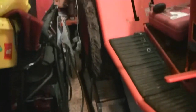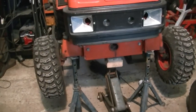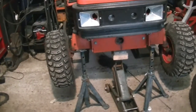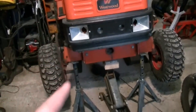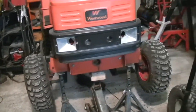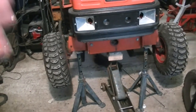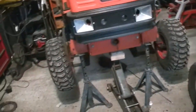I'll put the back end up on ramps and put the frame on the axle stands. Now don't do this — this is really a bad thing to do. If I take the engine out and disconnect the belt, there's nothing to stop the back wheels rolling down that ramp because it's in gear at the moment, but as soon as I take the belt off it can roll. So don't do this — this is just to get the bonnet off.